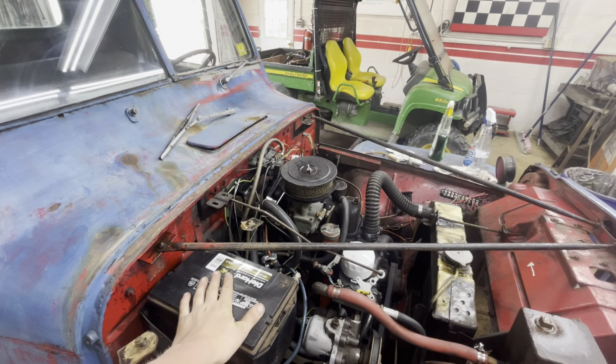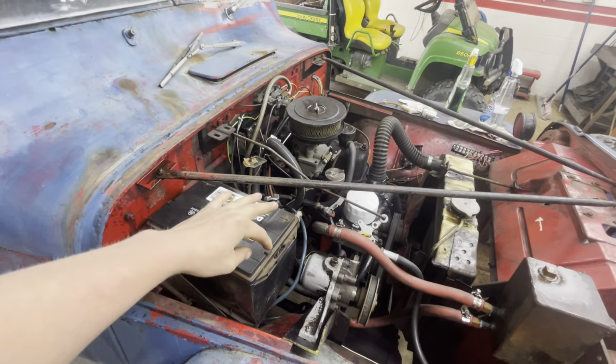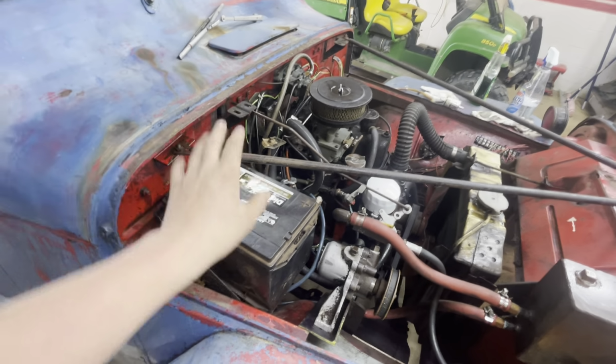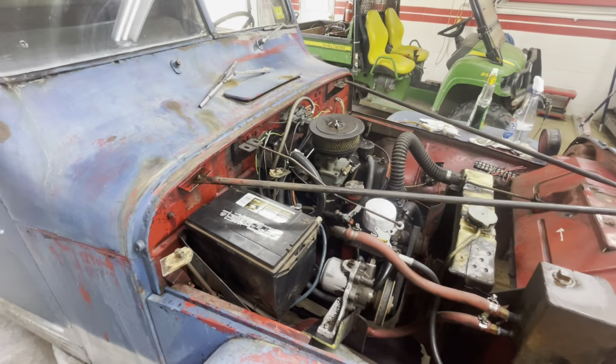And last night I checked, the lights all work and the horn works, but it's the wrong battery. It does not fit that cradle. It's the wrong side post, and it needs to be negative, positive here, negative there. Doesn't fit or reach. And these are the nut style. I need the terminal style, so totally wrong battery.